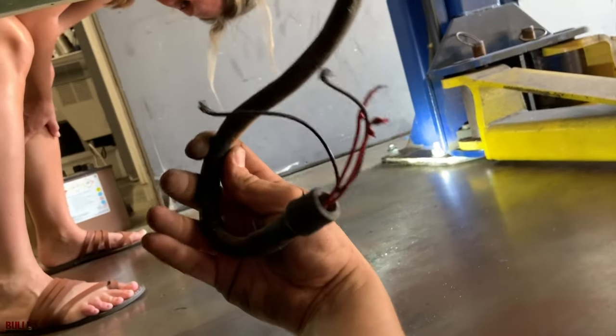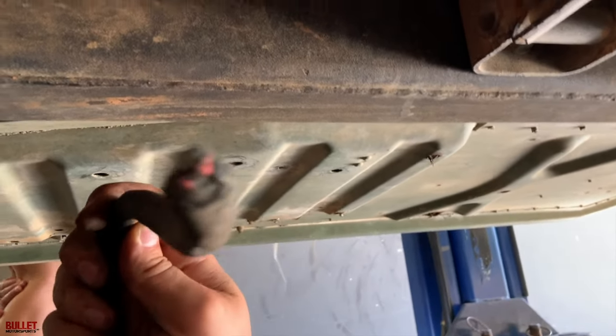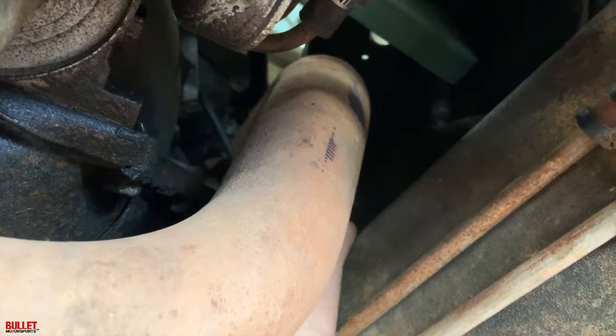Also it's touching the manifold. I'm worried because there's a fray here and it's positive and negative touching. The other side of this is probably still hooked up to the truck and that's most likely the issue.